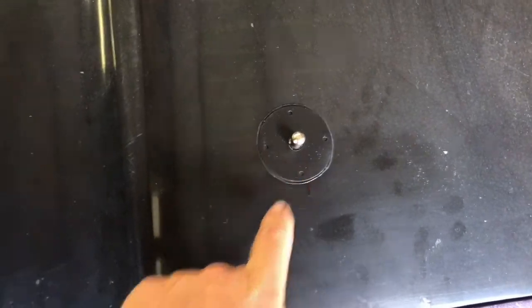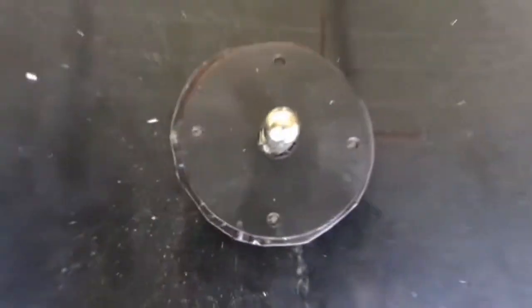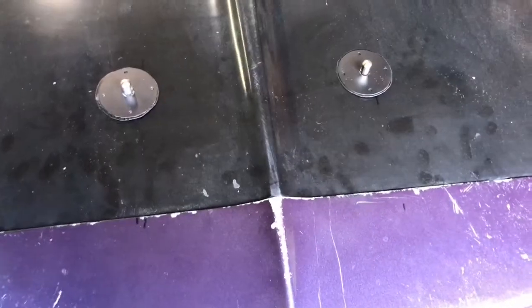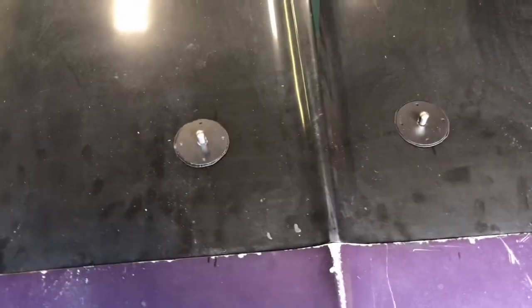The hood pins are installed. They line up pretty good - this one here is off just a little bit, not much. I'm going to pilot drill some pilot holes here for these four screws to sit down in. I made little rubber gaskets right here - there's the metal plate and there's the rubber gasket. I just made that out of the bottom of a black plastic tray, like the kind meat comes in from the store. I'll put you guys on time lapse while I drill these holes and set these screws in place. The hood is a little bit low but we'll see what we have to do.